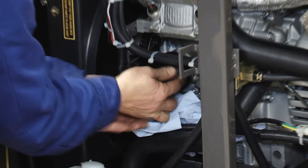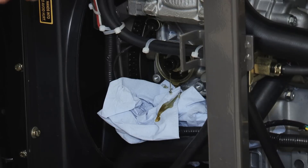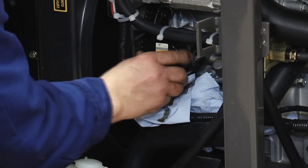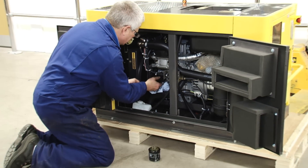When the oil is empty, change the oil filter. When replacing the new filter, just put a small amount of oil onto the rubber seal to help it screw into place.